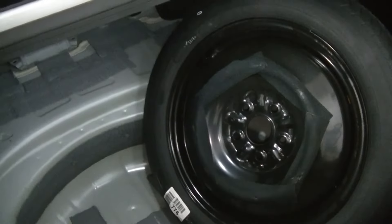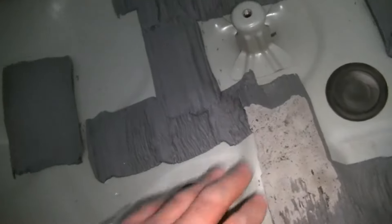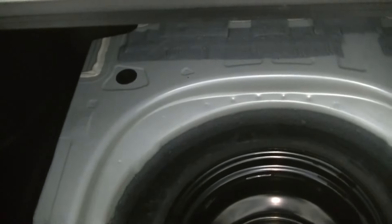In order for this to work, you have to flip your spare tire basically upside down, and the bass hub fits right in the hub of your spare tire. Because the spare tire was rocking around a little bit, I put some felt around the outer edge of the spare tire. I did have to grind some of this vibration-dampening material down just to give myself a little more room, so now your spare tire is going to come down into the spare tire well and it's much more stable. Now we're going to drop the bass hub right into this, and it comes with a threaded rod that will thread right into your factory spare tire holder.